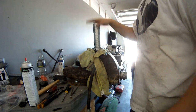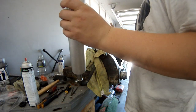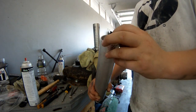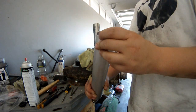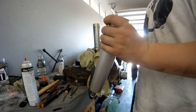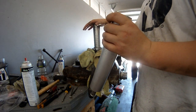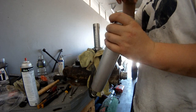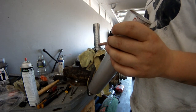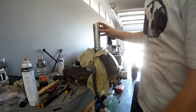At this point I really don't need to do anything else to the shock body. However, when I revalve and put the piston back in, I'll need to take the reservoir end cap out. To do that, it's much easier to mount it in the vise. I prefer just to drain the shock body rather than trying to seal the top, because pressing down the internal floating piston will drive air or oil back and it'll start spilling over.